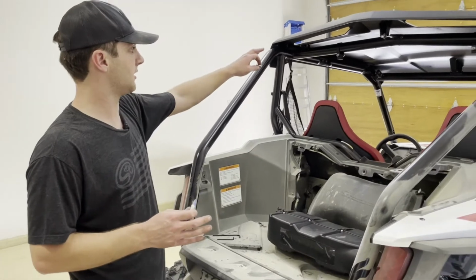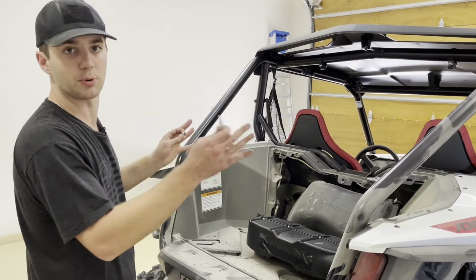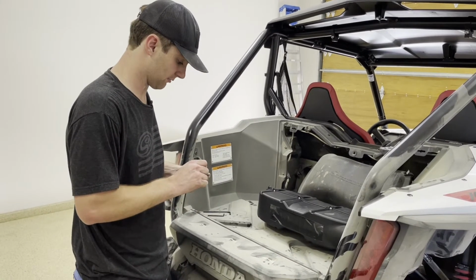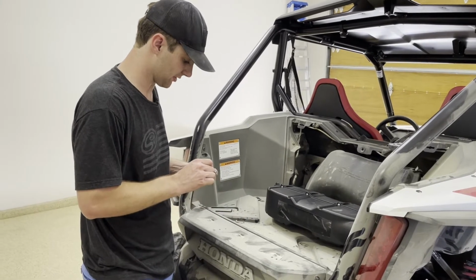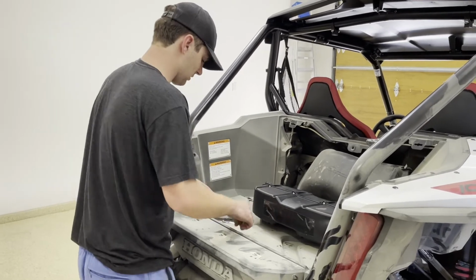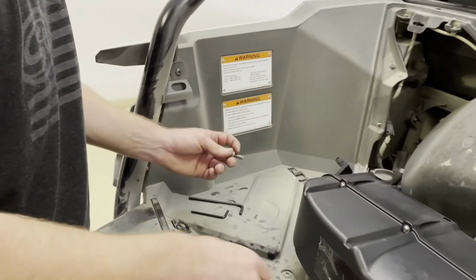We've now got the clamps and blocks set up, still loose so that we can size them perfectly for the width of the separator itself. I'm gonna go ahead and Loctite the last two remaining bolts in the hardware pack. These are gonna actually bolt the separator itself via the L brackets to the blocks. These will, same thing, washer, Loctited bolt.